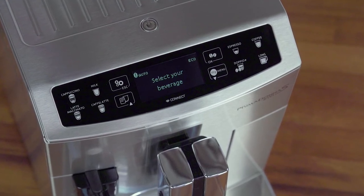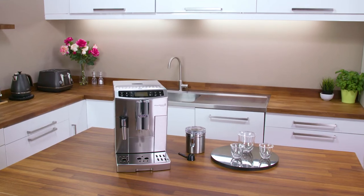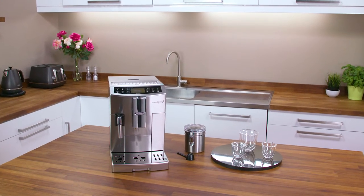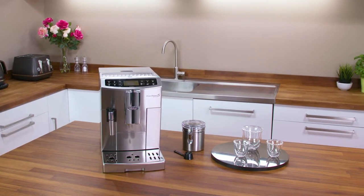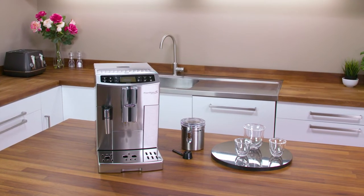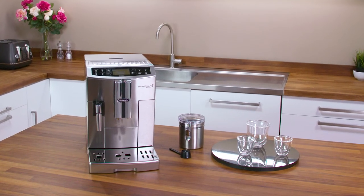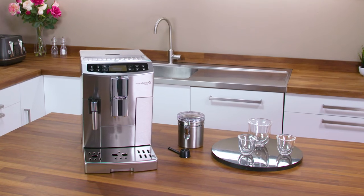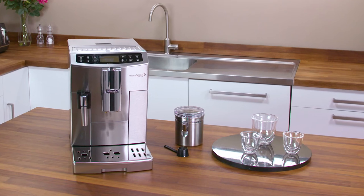The filter is now active and you can use the coffee machine. When "Replace Filter — Escape to Cancel, OK to Replace" appears on the display, you need to replace the filter. Follow the same procedure, then press Settings and the selection arrows until Maintenance appears between the two dotted lines. Press OK and choose Replace Filter.